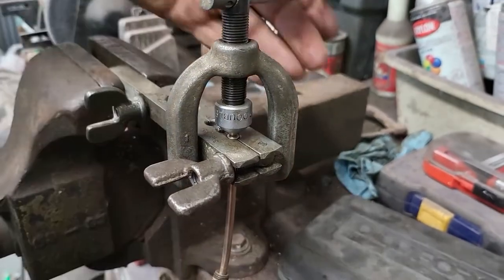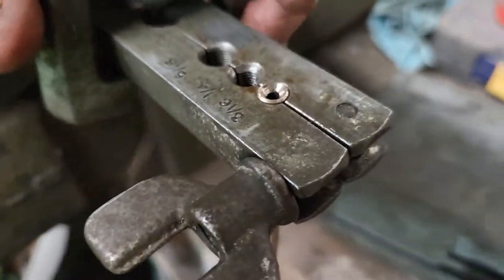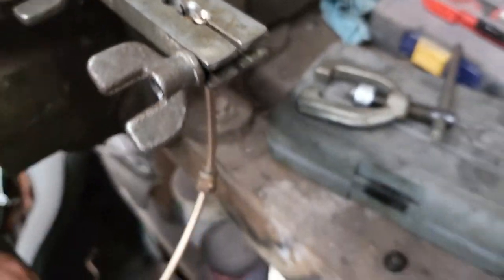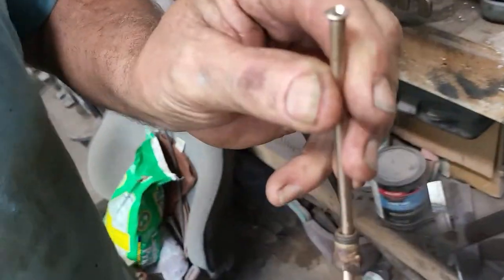We are now tightening it, and you want to tighten it until it kind of snugs up. You don't want to over-tighten it — it doesn't take Hercules to loosen it — and you are left with a fitting that should seal your brake lines perfectly. Loosen it up and we can take a closer look at it.